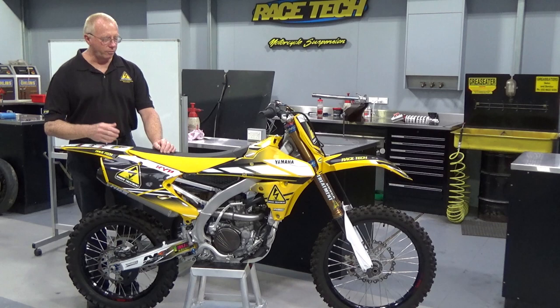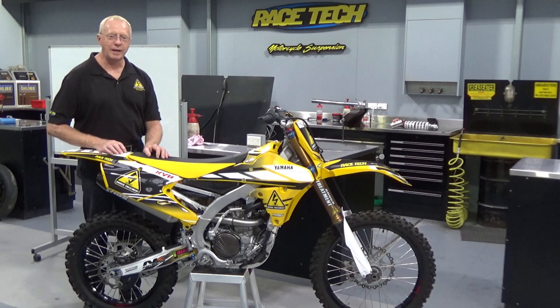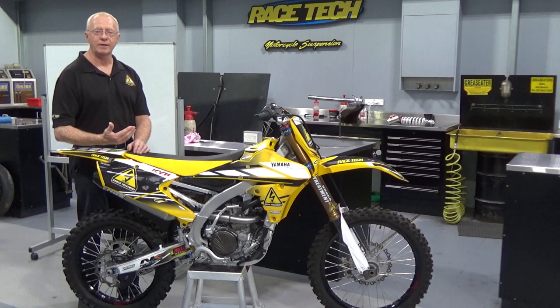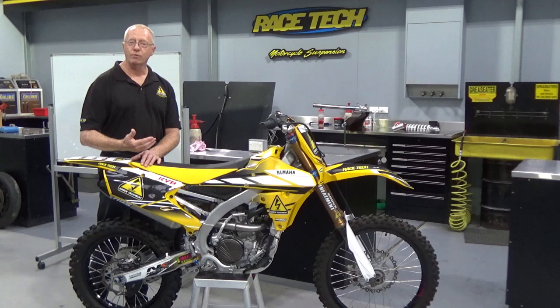Now, if you bought a new motorcycle, basically we want to go out, we want to enjoy ourselves and we want to get the most out of it. If you're buying a race bike, obviously you want to get the highest level of performance that you can. Everyone is well aware that we set the sag on the motorcycles, and most people think it's about the springs — making sure we've got the correct springs in the bike for the rider's weight. And certainly that's part of it, but it's actually the direction of force through the vehicle, how that force is going to push you and the bike down the track in the most efficient manner. And that all comes down to swing arm angles. There are force angles through the bike — we have chain force angles, a line of force through the swing arm, and we have the force actually at the tire that's actually pushing the bike.